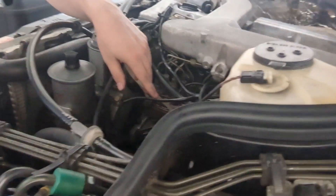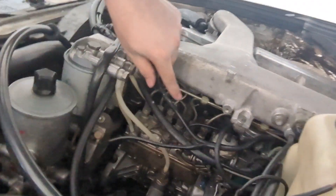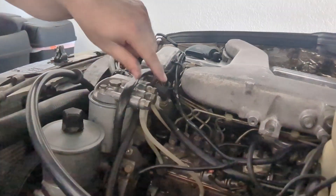It was definitely turning off — it was just not releasing. The workaround I would do in a parking lot was go up here and just pull the hose out to release the vacuum, then the stop lever goes right back up. I'd plug it back in, get back in the car and get going. And now it's working how it should. My guess is I plugged the vacuum lines in wrong last time when I did the ignition switch a couple months ago, and it only started happening after I did that.